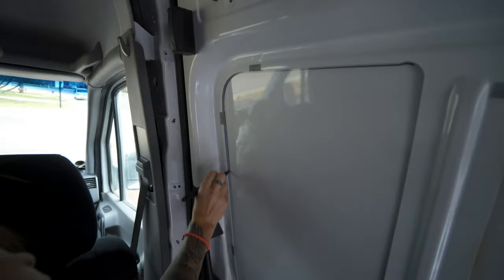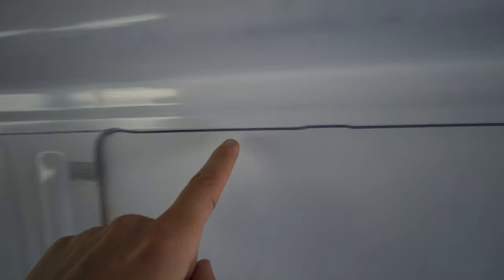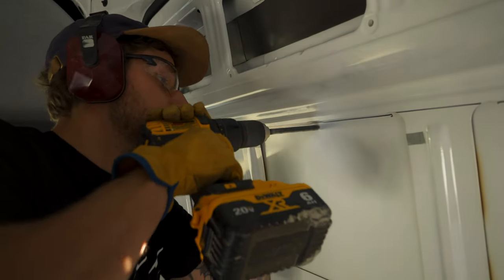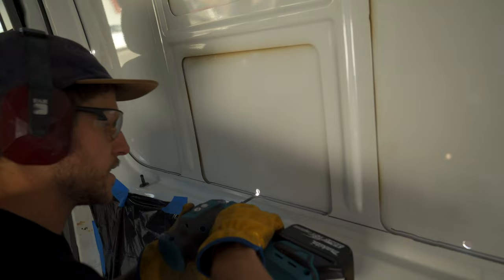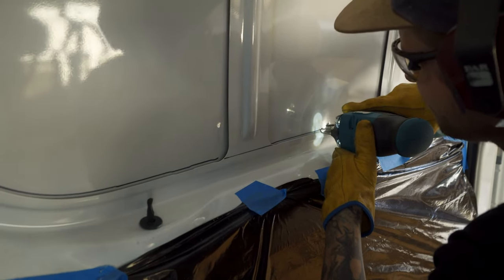You're going to want to start by tracing your cut line. We just followed the lip of the inner panel and used a straight edge to trace over the support beams where they pop out. Then it's time to grab your drill and place several holes all along the line that you just traced. I placed holes in all of the straight sections as well as every corner, so I had multiple entry spots for my jigsaw blade. I also removed the guide on my jigsaw because when I was cutting the flares, I was having a really hard time getting close on the corners — the guide kept hitting and scuffing, and I snapped a few blades, so this time around I just went without the guide entirely.